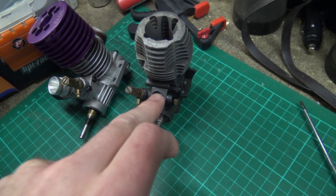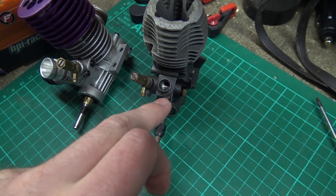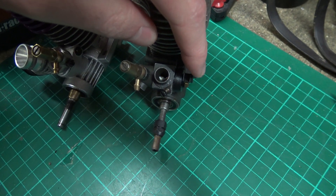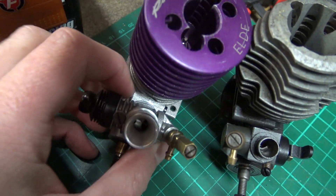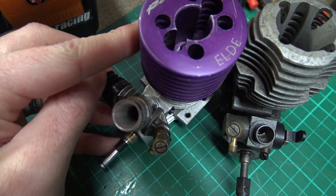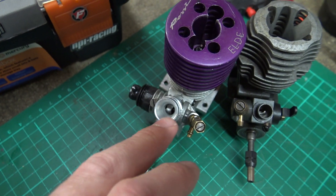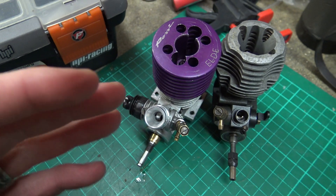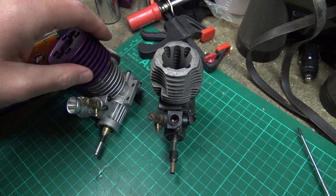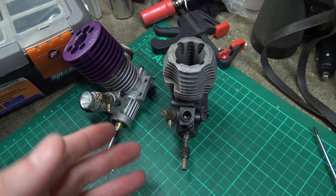All it does in very basic terms — because it's a very basic thing — it's just a screw, and it kind of pushes the throttle open as you turn it in. In this case it pushes the slider out as you turn the screw in. So it governs the amount of fuel and air that's allowed to go in when you're on a tick-over. Let's take one of the screws out and you'll see exactly what I mean and what it looks like.